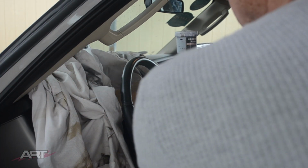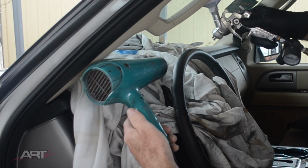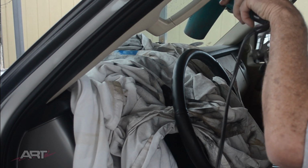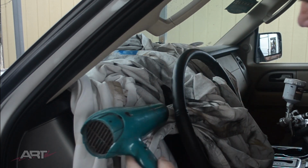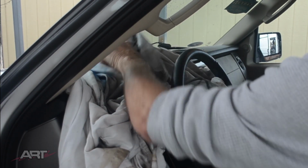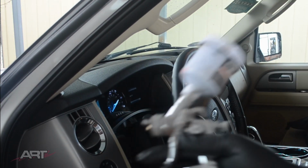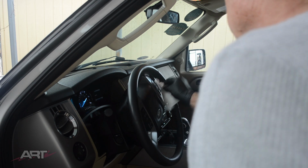A wipe in color to get me started while I'm getting the gun ready, right? It can be drying, and then my first spray coat goes on. The one thing I'm doing here is just a very light coat. This is the final coat. Using the hair dryer with a light coat just to make sure everything looks nice and even. Also, there's a slip additive in this particular coat, and crosslinker, of course. And as careful as we were with our drop cloth, there still could be some overspray, so we're just tidying everything up before we call it good.